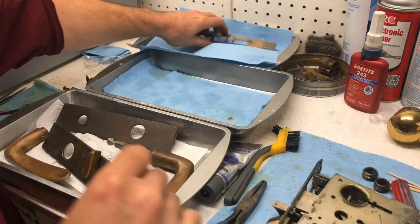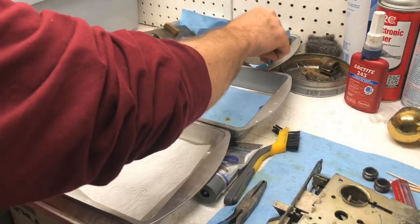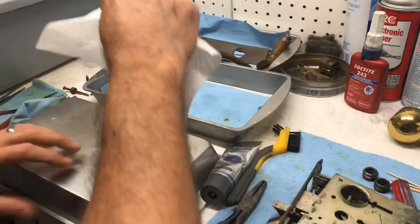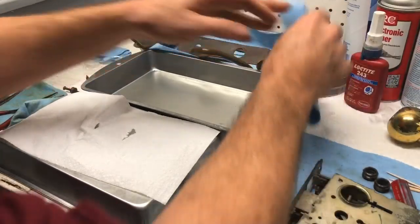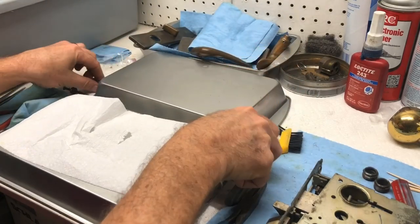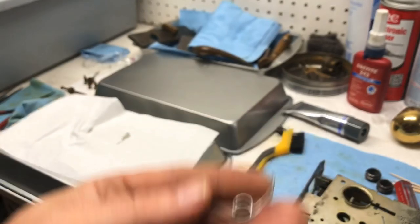On to the springs. So going around, you can just go to a hardware store and get a spring, they say. Just go to the hardware store and get a spring. Well, it's not that easy. There's different springs. True. Hardware stores, Home Depot, places like that. If you're overseas, I guess that place called Bunnings or whatever. Places like that have springs. Almost all of them are compression or extension springs, and they are not torsion springs.